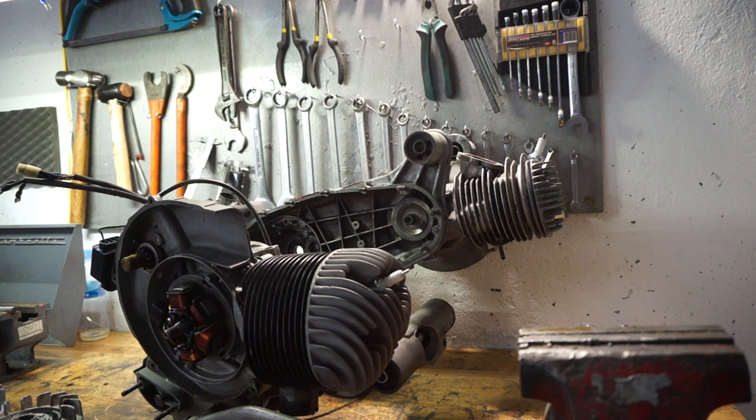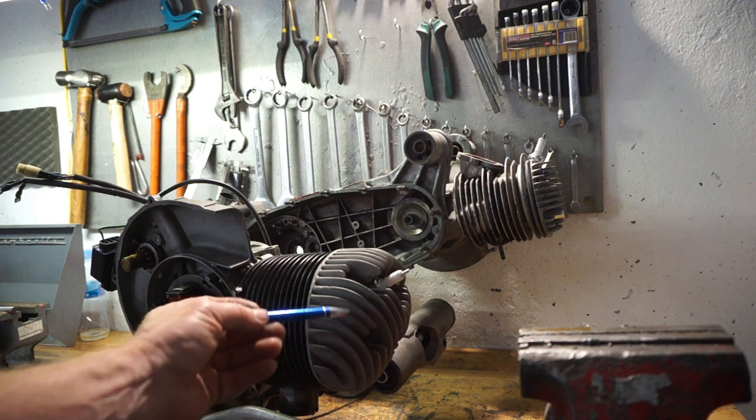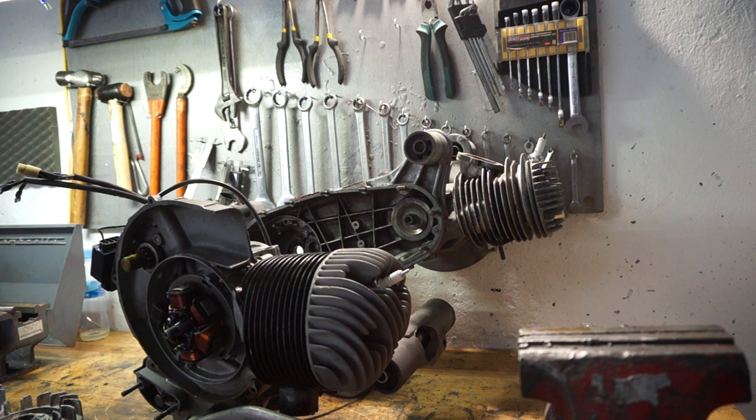So your barrel's about half the cooling capacity, and the cylinder head's about one third the cooling capacity of the Vespa. That's why this engine is renowned for its reliability - the cranks are no better, the pistons are no better, the ignition system's exactly the same. Why is it reliable? It's cooler. Engine temperature is the main reason for reliability. That's why we turn to water cooling, because engine reliability is better - you maintain optimum temperature all the time.